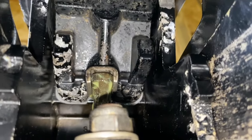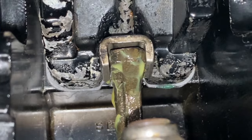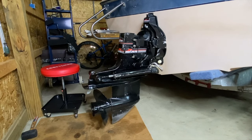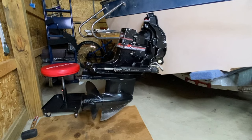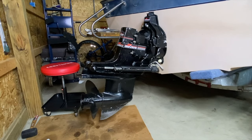Coming underneath the out drive for a close-up view of the shift lever and the two mating together. Double-check every single thing, and if all looks good, hop into the captain's seat and trim the out drive up. The out drive is now further from the ground so I can continue working on it without damaging the lower skeg or propeller. That's it — that is how you install your Alpha 1 Gen 1 MerCruiser out drive. What we will do next is film a video on how to properly and safely realign and recalibrate your trim sender and trim limit switch. On the starboard side is your trim sender, and on port side is your trim limit — we have not yet realigned the brand new trim sender and trim limit switches installed in previous videos.